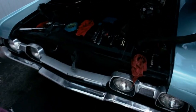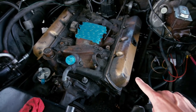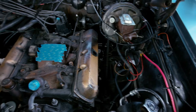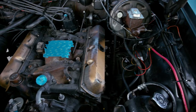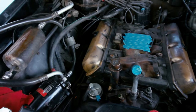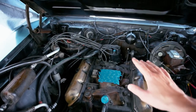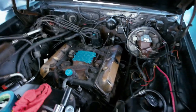Today is the next day of the project. We are cleaning out the engine — it needs a good degreasing and the carburetors cleaned. We're going to run a compression test on each of the cylinders to make sure there are no bad cylinders, and we also want to know if it's the high compression or low compression version of the engine. There's also a possibility we have a cracked motor mount, so we're going to check for that as well. When the whole thing goes back together it's going to have a new electronic distributor to replace the old one. Let's get to it.